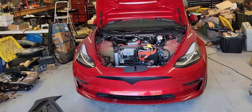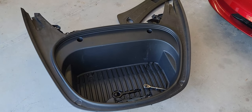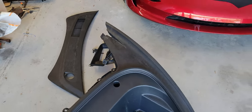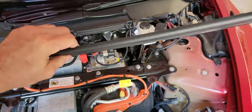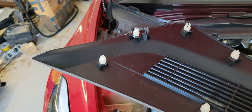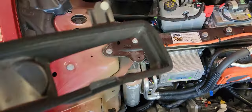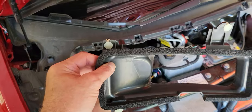Okay, I'm over at the camera and I'm going to get some close-ups. The frunk is covered by a large piece of plastic and these smaller pieces of plastic. The procedure to remove them is: you pop this off — it goes up in here, you pop it off by hand. These things come right out. Just get your fingers around each one, pull them up, and this will come out, exposing the top. Then next, you pull this out — same idea, there are just three clips you pop out where you see those little white things.